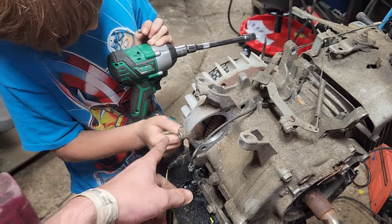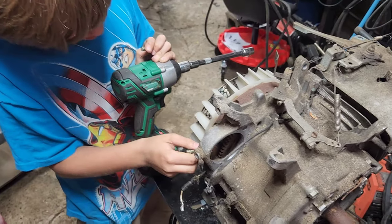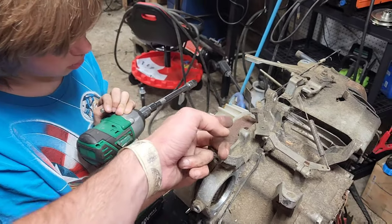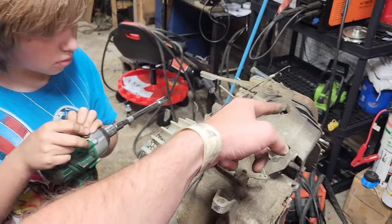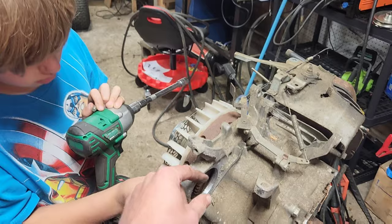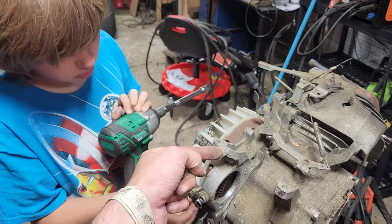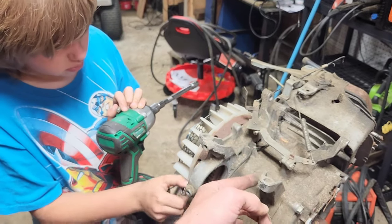This is magnetic — that's the flywheel magnet, which interacts with the coil in order to give you spark. When the magnet goes flying past the coil, it causes the spark. But if you have this grounded out, then the magnet going past the coil can't make it spark and the engine dies.